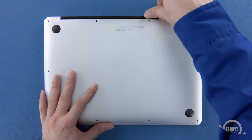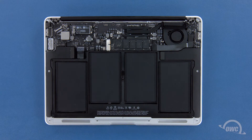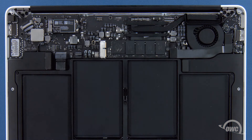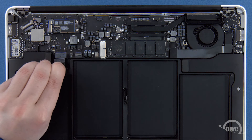There's a snap on the underside near the center, so you may have to pull a bit to detach it. The SSD module is located here. First, we'll need to detach the battery connector, which is located here. To detach the battery, simply pull back on this plastic tab until the connector comes free.